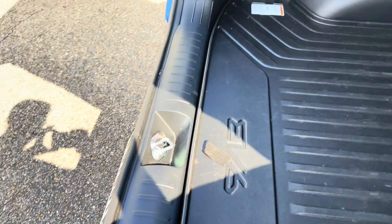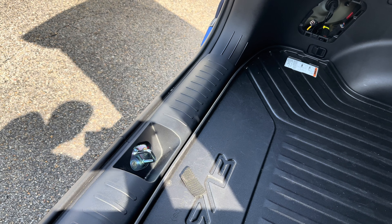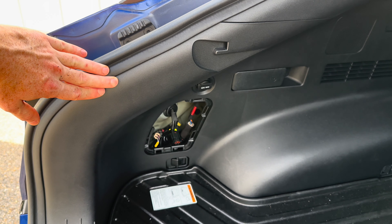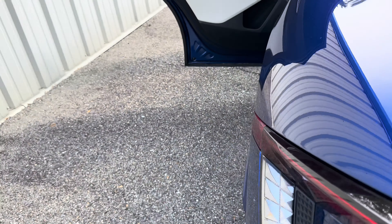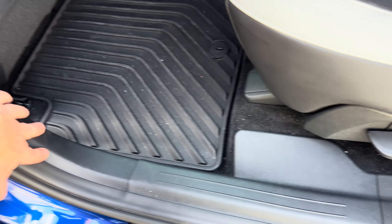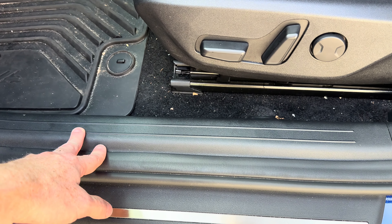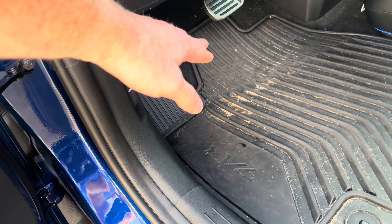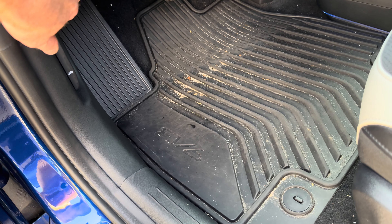Installing the harness is quite simple. You have to remove this threshold that goes between the two tail lamps underneath the tailgate door — it's held in by two plastic fasteners and it lifts out. I zip tied the harness underneath there. This cargo panel will need to be loosened, not completely removed, to give enough space to route the wire towards the front — it's very easy to do and pops right back into place. This door threshold will also have to be removed, it just pops out. Nothing has to be done with the door pillar trim. The driver's side door threshold pops out as well, and then this knee panel or kick panel trim will need to be removed too — it pops out and rotates away from the knob. That allows the harness to be routed from the back of the car to the front and allows you to get connections for the turn signal wires.